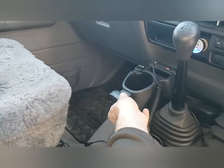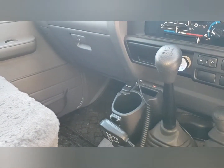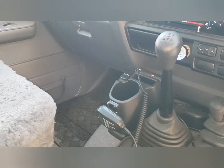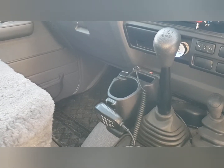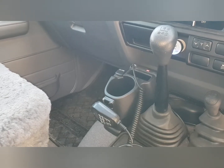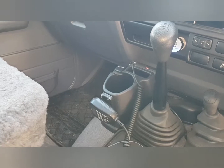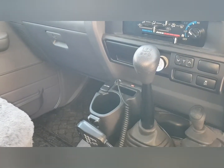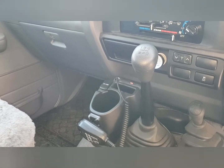So we've got it balanced, so both myself and Kylie can hear what's going on, and that works really well. I've also got an additional handheld radio which we'll have set to just a monitoring station, particularly on the Canning. We've got one radio which will be tuned into all of us travelling together, and the other one tuned to channel 40, so we can listen to who else is on the track and also be able to communicate with them. So that works really well, and I recommend to anyone to have a two radio system, whether it be inbuilt or one inbuilt and one handheld.